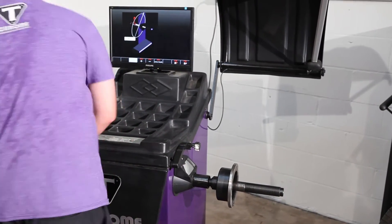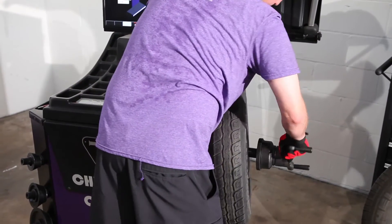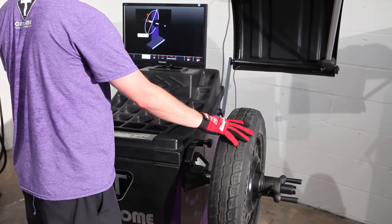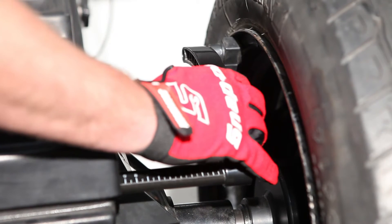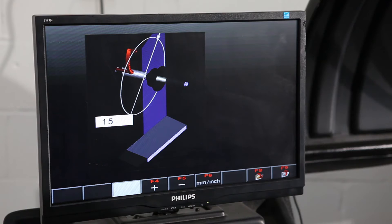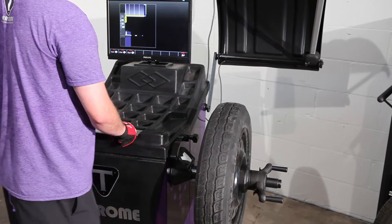Take the calibration wheel and place it on the machine. Use a 14 or 15 inch steel rim to calibrate your machine. Move the handle to touch the edge of the rim. If you have a 14 inch, leave it as is. If you have a 15 inch, press F4 to raise it up to 15 inch, then touch the edge of the rim and press F8 to save. We're done with the auto rule calibrate — press F9 to save.